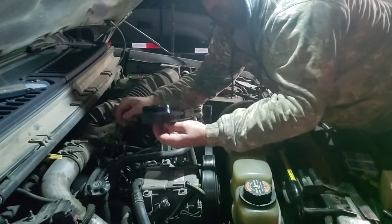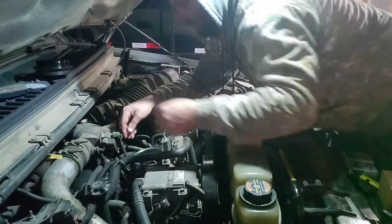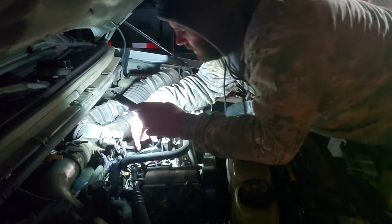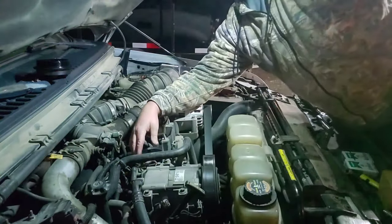When you take all this stuff off, you're going to have fuel spilling everywhere — I'm not really concerned about that too much. There is actually a fuel drain for the bowl — I just opened it up. That will drain out onto the ground, so if you're doing this on a nice pretty driveway, it's going to get messy. You've got to drain the fuel, then we'll get the fuel filter out.